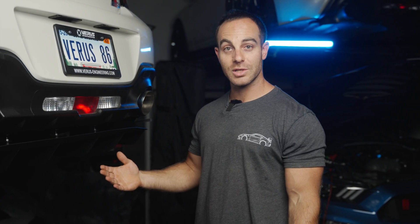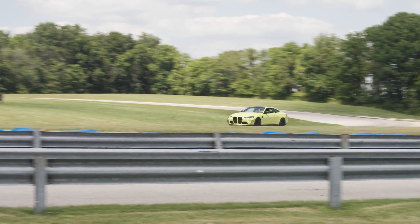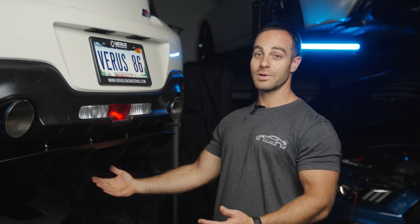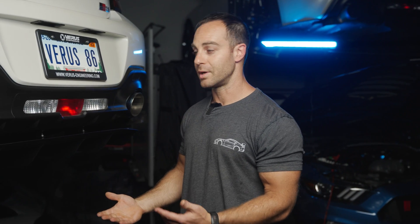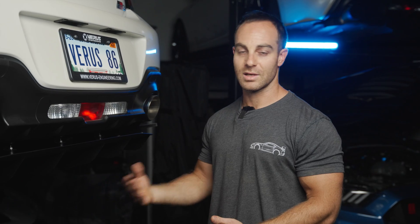Generally speaking, we look at the CFD pressure plot and you can look at OEM cars. The M4 actually does a really good job from the factory — it's actually the muffler. As soon as you remove that exhaust though, you no longer get that diffuser effect. So we may produce rear diffusers for the M4 and M2 as well — it really depends on the market. The first insight into whether a car needs a rear diffuser is going to be CFD and customers telling us that the car feels floaty at high speeds.